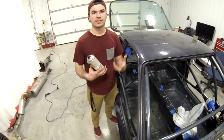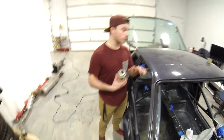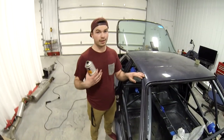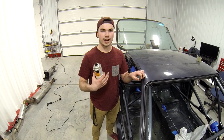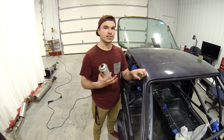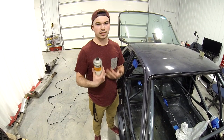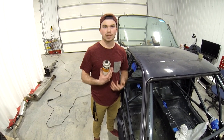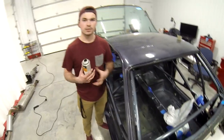But they mix a new batch every day at the factory. Correct. There's a lot that goes into it. Even as far as humidity when it's sprayed, temperature, all of that comes into play. Gun pressure. So as a painter, you've got to know all of this, and it's a lot more in depth than just using your rattle can. But obviously, that's why this is just close. Even if it is the right color, it's just close because of the metallic stuff like that. The way it lays is a lot different.